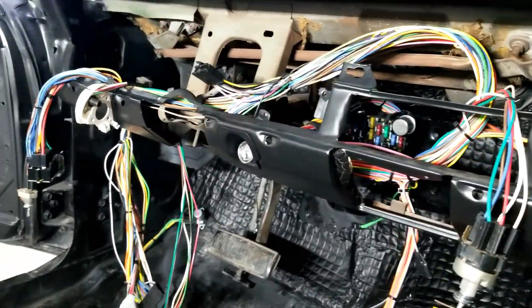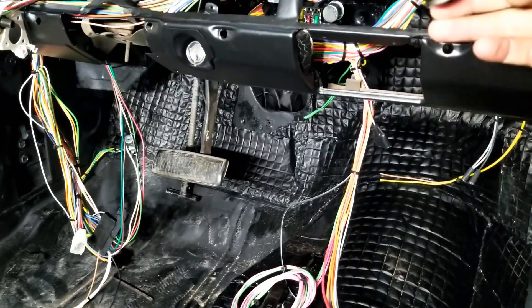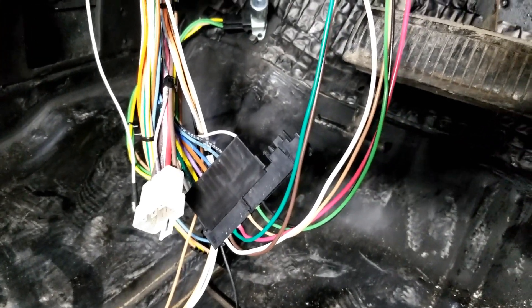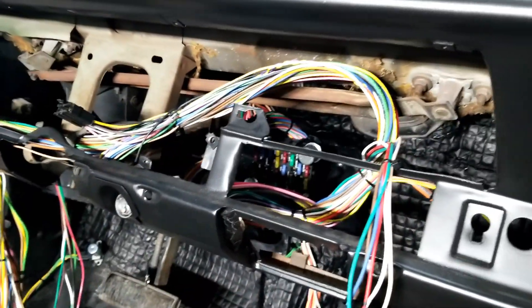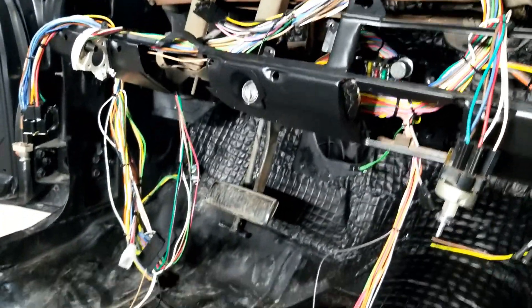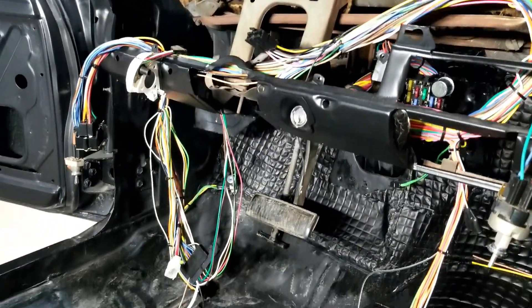This is not an easy task to film by any means. As you can see back down in there, we've got our fuse block populated with fuses and whatnot. It is mounted to the firewall. We've got some things just kind of generally routed — we've got our wiper switch and turn signal switch plugged in down there. We did have to re-pin the turn signal switch to a GM-style connector. The kit comes with a new headlight switch and hazard switch, and we've got a dimmer switch back down in there. This does come fairly well cable managed for you; however, it will take some extreme amount of patience to get this through the factory wiring looms and hooks the way it was intended. But overall, pretty pleased so far.